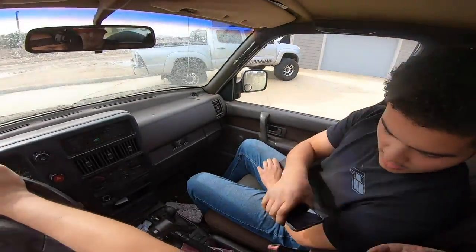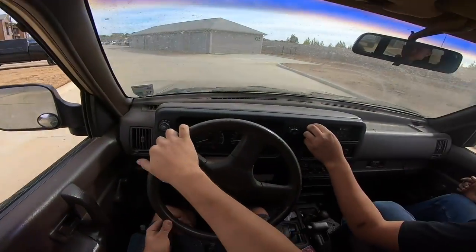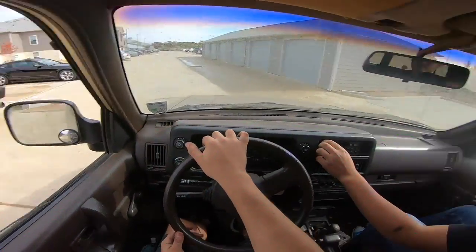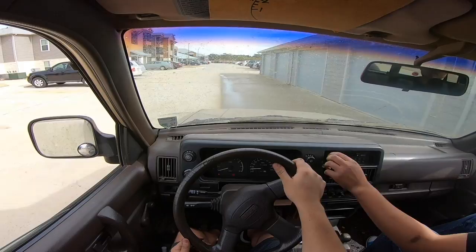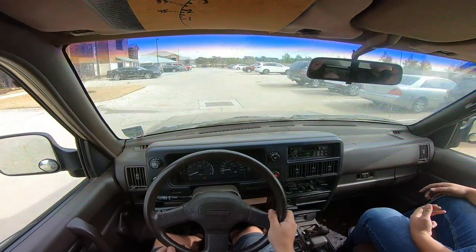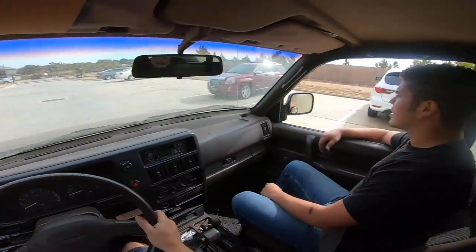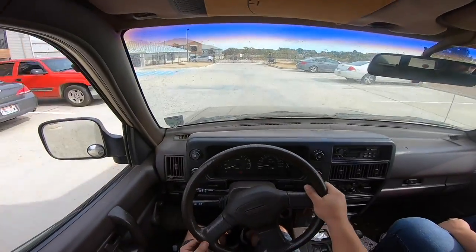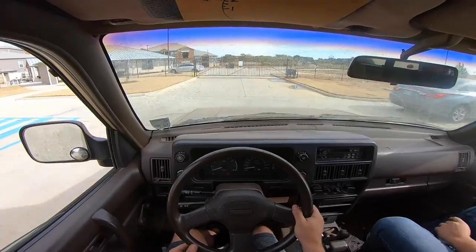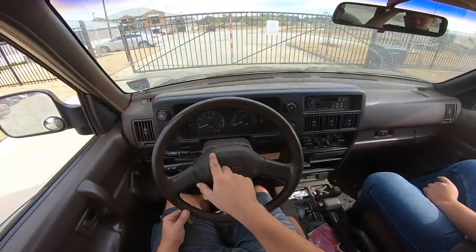Power steering's a little low. Hold up. I'm just letting you know, there's pieces of cat under the car as well, so it was shooting it out from under the car. Oh, exhaust has a little hole. That's all right. I'm telling you, this was like a five-foot spread of cat. The dash says O2. That's what it probably is. Your O2 sensor blew out.